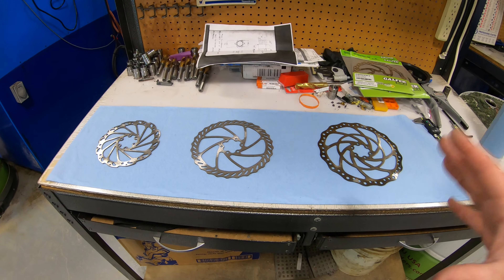We do try and put these on some of our bikes like the Blackbird. The Hydra, for example, comes with 203 millimeter rotors — bikes that have a little bit more power or are a little bit faster. But there's one more thing to discuss besides just diameter, which is the thickness. This right here is a 180 millimeter rotor from Galfer, and if you look right in the corner, it says it is two millimeters thick. How thick is a normal rotor anyway? All three of these that I've showed you are 1.8 millimeters thick — that is the standard size.